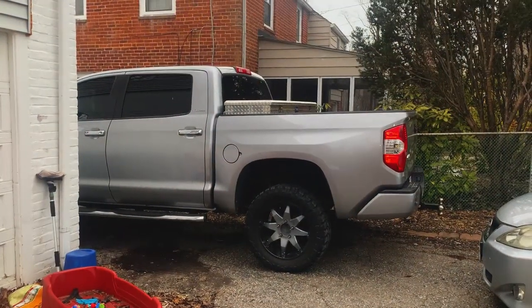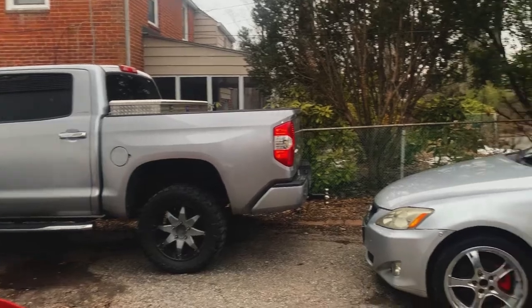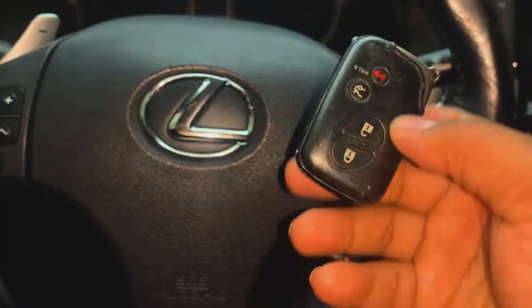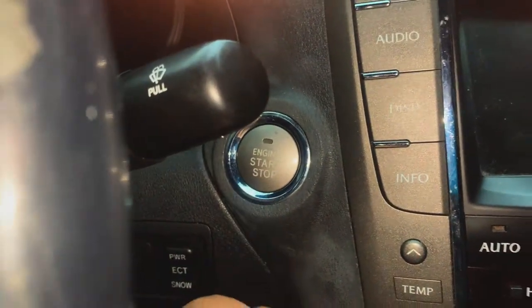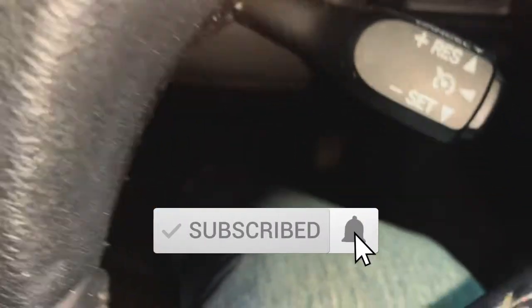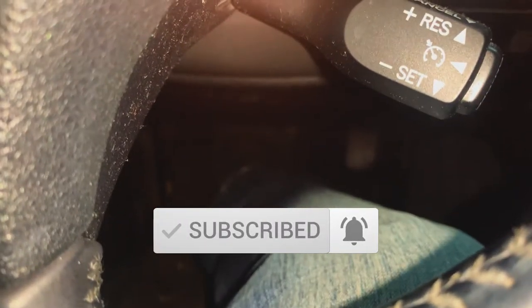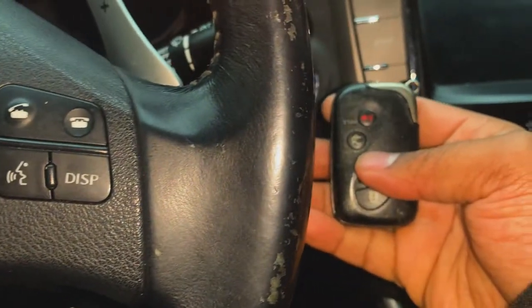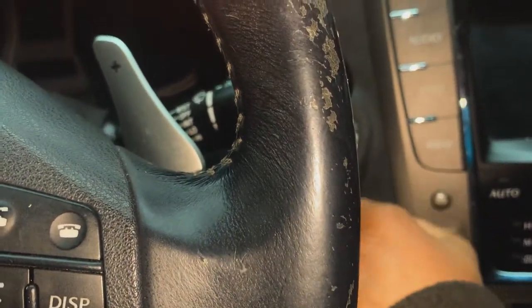We got the big old Tonka truck and then my play toy. There's no battery in here — we're basically going to resemble a true dead battery. So I'm going to put my foot on the brake as we normally do and press the engine start button. As you can see, key is not detected. So what I'm going to do is release my foot from the brake, press again, put my foot back on the brake, take my key fob and bring it up close to the button. Now as you can see, it went green.